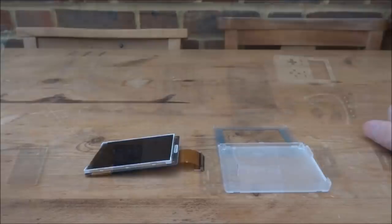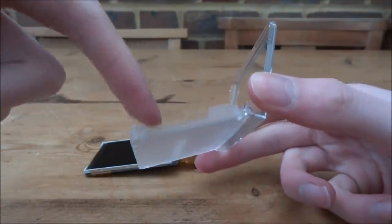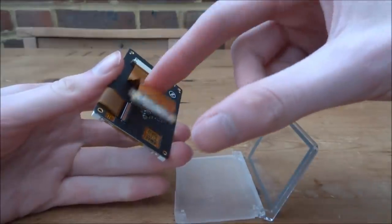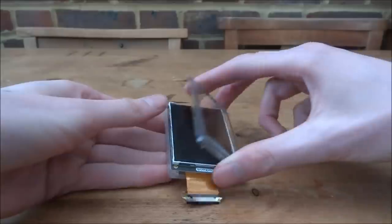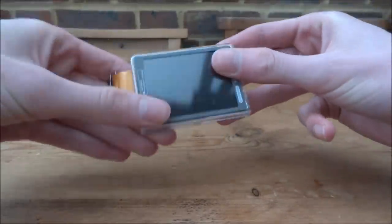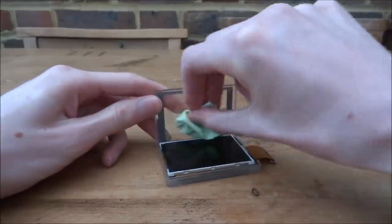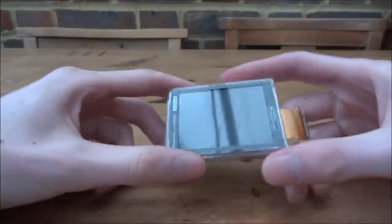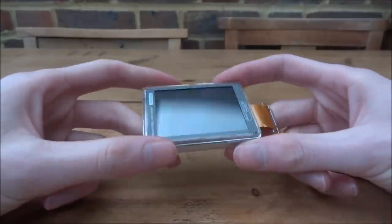For the screen module, get the two plastic pieces — the screen part and the backing piece with a slot — and make sure they're clipped together. Peel off the screen's plastic protector, bend the ribbon cable backwards, then sit the screen in and clip it onto the pegs and close it. Try not to get any hairs trapped inside. The ribbon cable should be bent back and you can move it in and out.